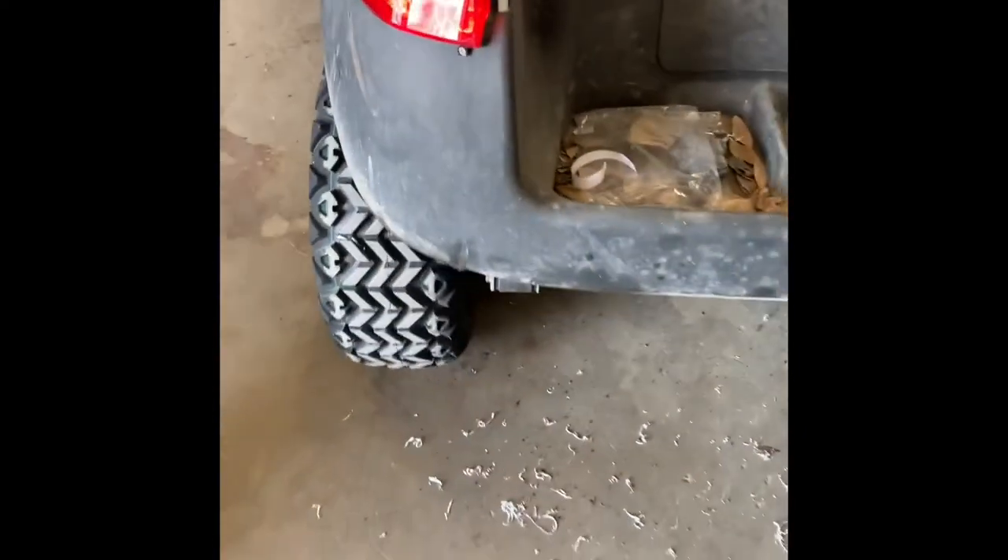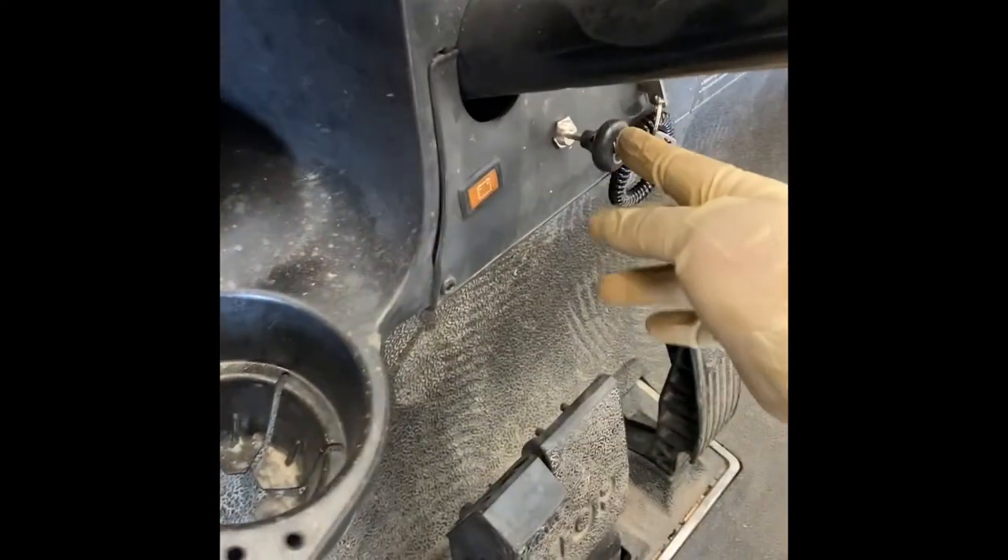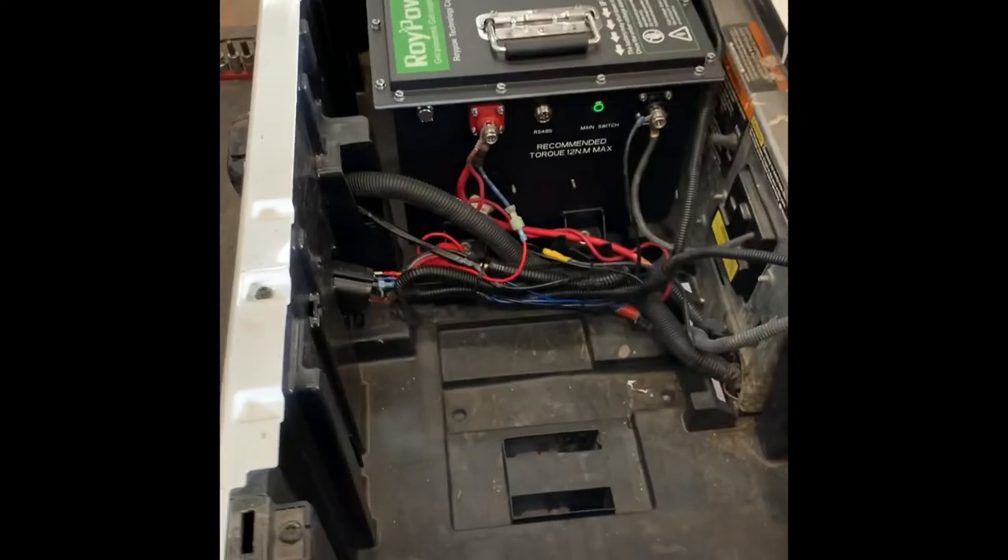I've got everything zip tied out of the way, with the harness going up away from the steering rack — all done. The voltage reducer is mounted and plugged in, everything's good. Now let's put it in Run, turn the key on — that activates the voltage reducer. There you go! Let's check the tail lights — on. Now you'll see that when you turn off the key, there go the lights. So even though the switch is on, it's really controlled by the key — the key will kill the headlight. Even if you forget and leave the switch on, turn off the key and boom, it's off. That is the light kit — hope you all enjoyed watching, see you soon.